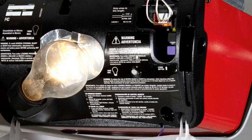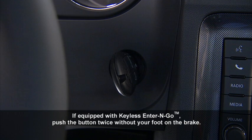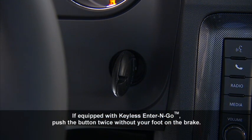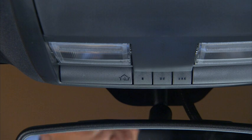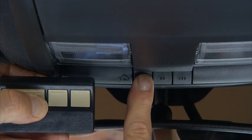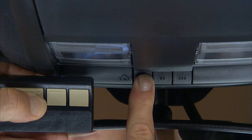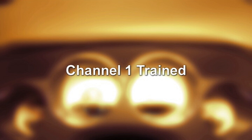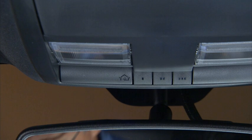So let's talk about how to program a rolling code. To begin programming, turn the ignition switch to the on-run position, but don't start the engine, and hold the battery side of your handheld transmitter away from the HomeLink button you wish to program. Place the handheld transmitter 1 to 3 inches, or 3 to 8 centimeters, away from the HomeLink button while keeping the EVIC in view. Simultaneously press and hold both the chosen HomeLink button and the handheld transmitter button until the EVIC display changes from Channel Training to Channel Trained, then release both buttons.